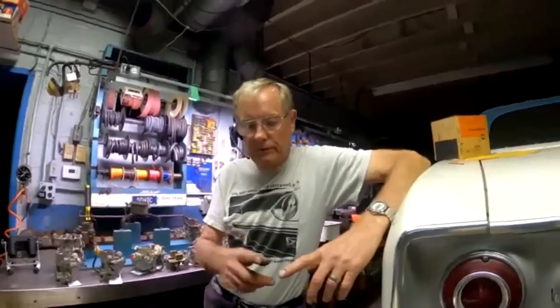Yeah. Okay. So I guess I'd first have to ask, are you encountering a problem, a drivability problem? Because if you're not, don't mess with it. The factory knew what they were doing. We just got to compensate for what's changed since then. And that's going to be the fuel quality, mainly the fuel quality. And then your particular environment where you're driving the car. So a stock 66 would have had probably 50s or 51s in it. If it's running fine like that, I'll leave it.